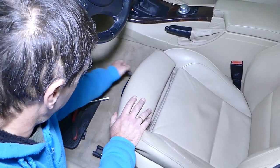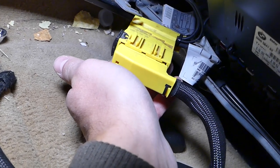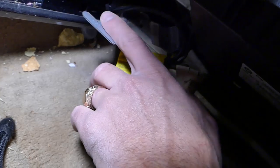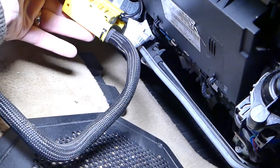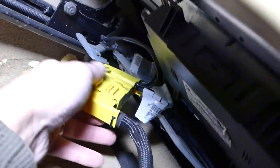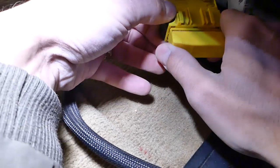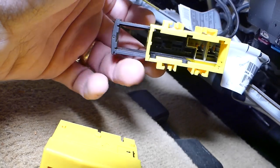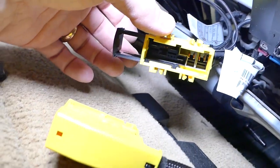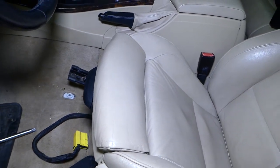The seat will lean back a little bit. Now we need to disconnect all the wiring harness under the seat. This connector is supposed to stay clipped in — if it's not installed correctly it can trigger airbag codes. Pull the black locking tab out to disconnect. Inspect that your wires are seated properly, because if they slide out and are reinserted incorrectly you can damage the pins and get airbag or seat codes.